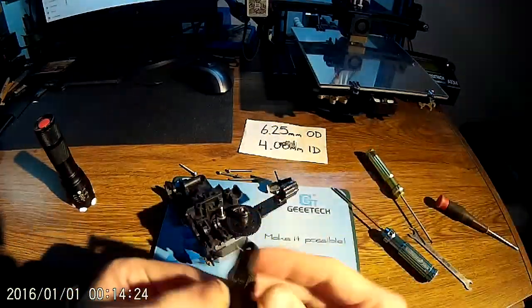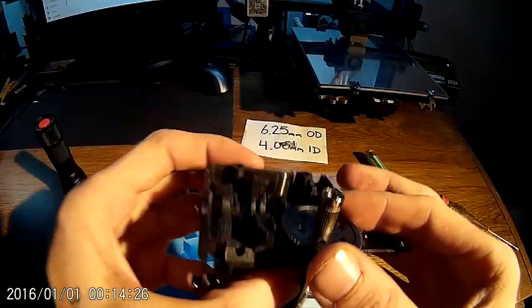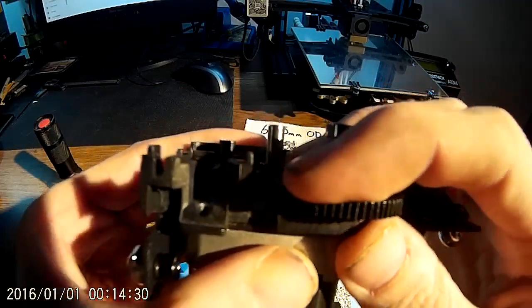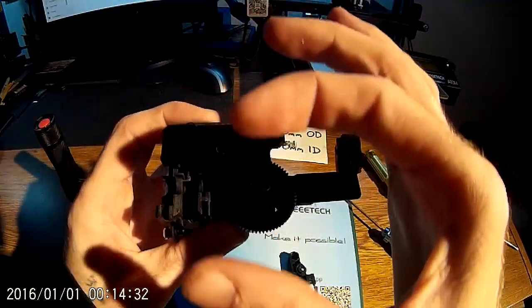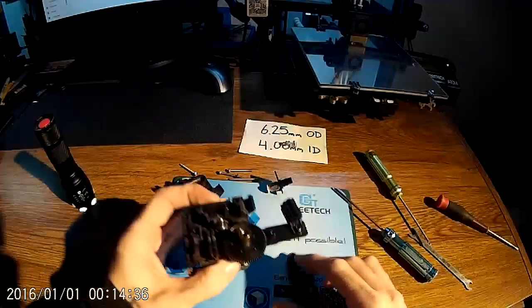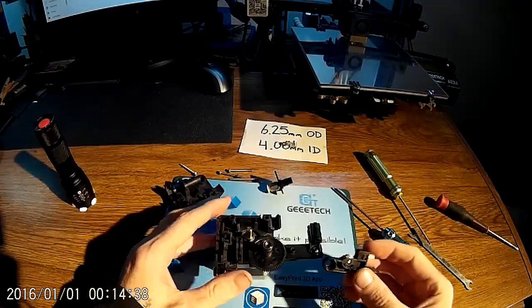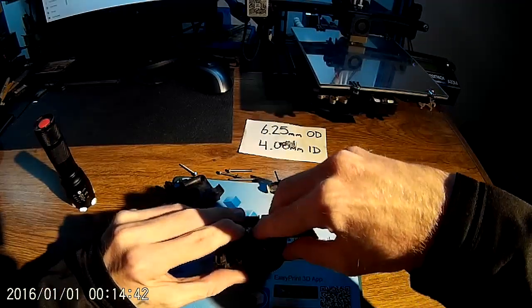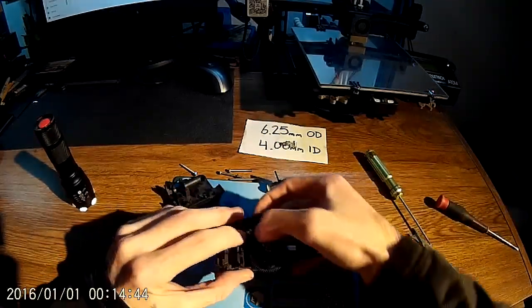That's because this plastic gear, and all plastic gears, are never perfectly level or perfectly round. They're sometimes oblong or they dip up and down. I know that because I used to race RC cars and every plastic diff in existence was like that or had some form of tiny defect like that.